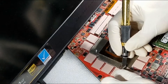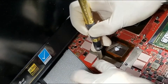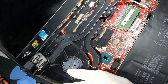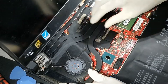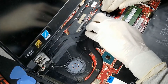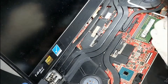Now remove the plastic cover of the thermal pads. If you are using the same ones I used, the mesh side should be facing up as mentioned, not down, so that it will be easier to remove them. Hold the heatsink with both hands, get it under the screen, then position it into place. Apply light pressure above the dies to make sure that the paste is flattened enough all over the die surface. Then put the screws back in the correct numbered order, starting from one, then do the remaining ones.